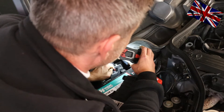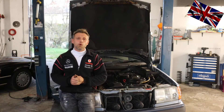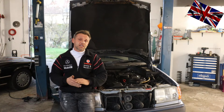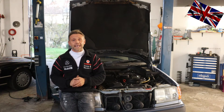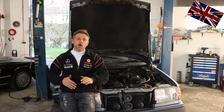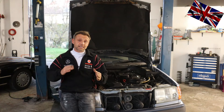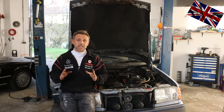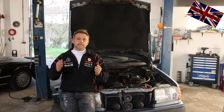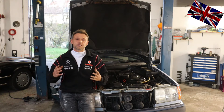And hoses, seals, flow divider, system pressure, and upper and lower chamber. This is how to do it with a W124 300E M103 engine type E30 from 1991. First thing to check are always seals, fuel lines and hoses — it is useless to connect your pressure gauge anywhere when fuel pressure is blown out at some untied seal or old and rotten braided hose. I will include the information charts and guidelines concerning a 560 SL engine M117, as they have pretty much the same procedure.